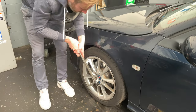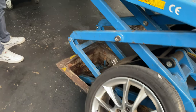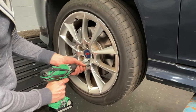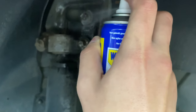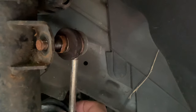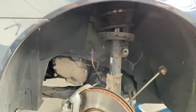Finally it's installation day. I got help from two mates and we rented a car lift to make life easier. We start by loosening the wheel bolts with a breaker bar and removing the wheels once the car is on the lift. With all the bolts visible, we clean them up and spray them with WD-40 penetrating fluid. First we detach the sway bar end links from the shock absorber using a 17mm open-ended wrench between the rubber boot and mounting points so the threaded lock doesn't spin.